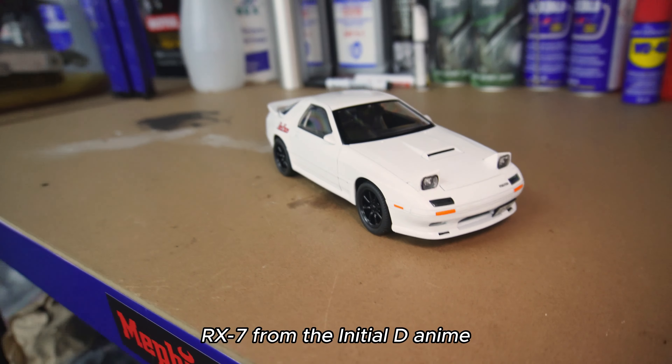As you can see by the amount of parts that's right behind me, there's a problem with the car. Even though it looks perfect and in mint condition from the outside and also on the inside — it is super clean in here — this baby really has some problems and this is gonna be a lot of work. The problem is the engine. After all, it's the rotary. The biggest problem, apart from the engine situation, is that this car has actually been sitting in a barn for 14 years. The good part is that it actually runs — and it runs decent — but this thing really needs a rebuild. All of the belts are super brittle already. Compression is also not the best on this engine; it's right around 90 psi, which is not the worst, but also not the best. Good thing though, it runs.